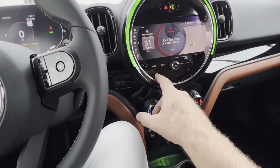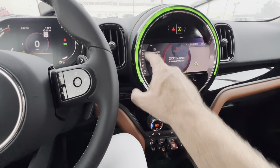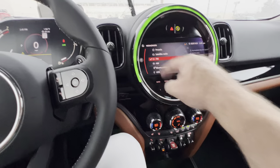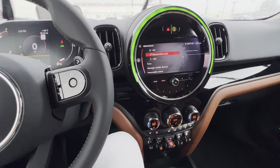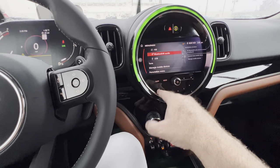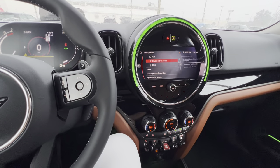The other presets — probably button one I would make CarPlay. That would be in your media after you pair your phone. Instead of just these selections, scroll down and CarPlay will be right around here — you'd highlight it like Bluetooth audio, press and hold it, and now you've got CarPlay on button one to go right to it anytime.